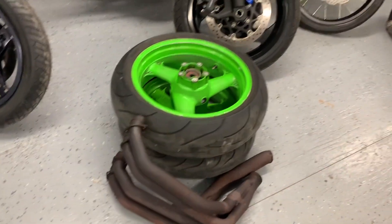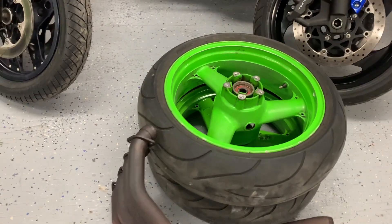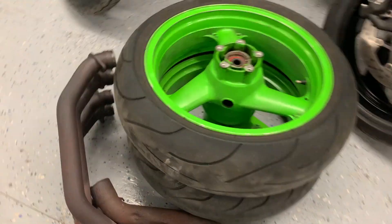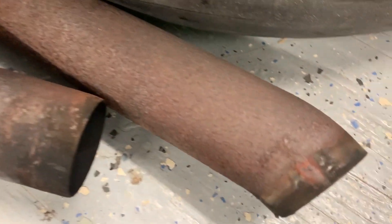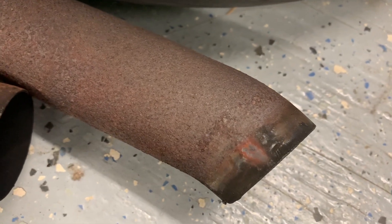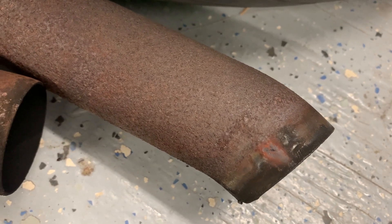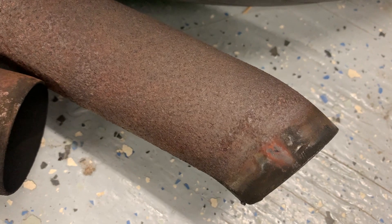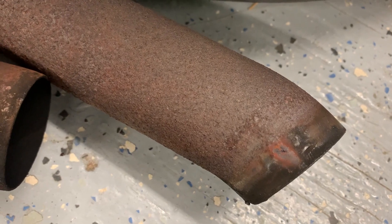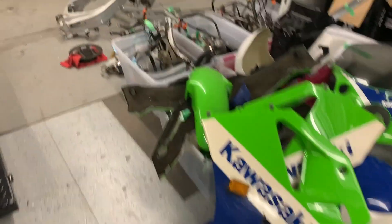These are going to be the only things I end up outsourcing. The pipes are going to go to media blast in the next few days, and I'm taking these wheels in to get the tires taken off. The other thing I noticed when I took the pipes apart is there's only about half an inch of pipe inside the muffler where it sits in the end of the silencer — that's not really very much. You want to get more pipe in there than that.